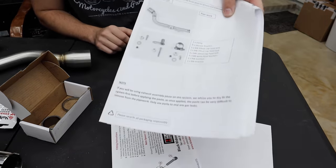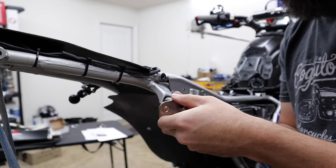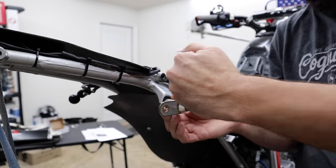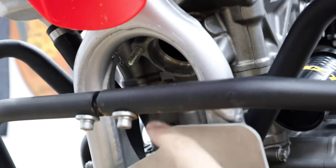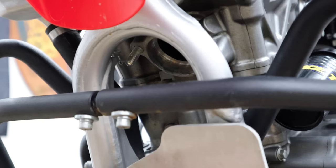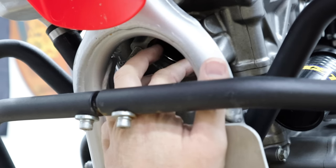Let's get this thing on. Step one is to set everything up and make it look like the picture. What you need is the bracket — the long bolt with one of these dome washers. What I love about this is it already has a pretty good spacer built in, and that's important because with a supermoto wheel, when it comes up it can hit the exhaust. Even bikes with a factory supermoto version never seem to account for that — they always build the exhaust for the dirt version. But this already looks pretty good. Now, taking the stock exhaust off — go back to the first video — you need to get the gasket out. The stock one is really in there. Here's your new one; don't reuse the old gasket. I love that they send you one. I dabbed it with a little bit of grease to just make it sit in there — once the bike starts for the first time it'll burn off, no big deal.